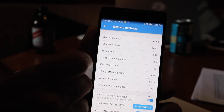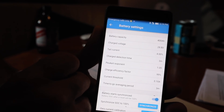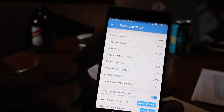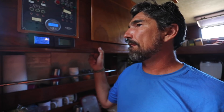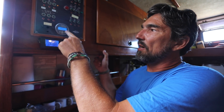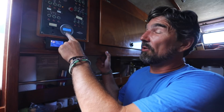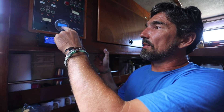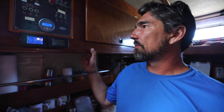As for the battery configuration, this is where you set the capacity and define when they're 100% charged — the manufacturer says 28.8 volts. This is probably the most important setting: the charge efficiency factor. When I installed these lithium batteries, I needed to change that from around 70% up to 99%, which is correct for lithium. This is the actual physical unit itself — right now it's showing voltage, current, and power being put in. I think having power displayed is pretty cool, in addition to amp-hours used, which is at minus 129. The state of charge percentage is really nice because you don't have to do the calculation in your head — we're at 70% and still have a while before we need to worry about charging.